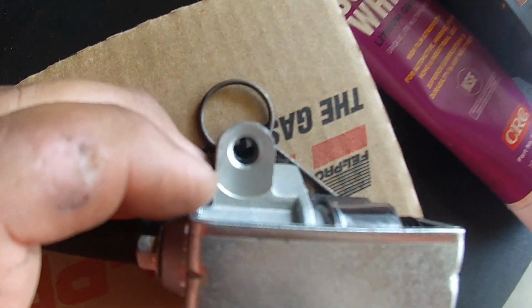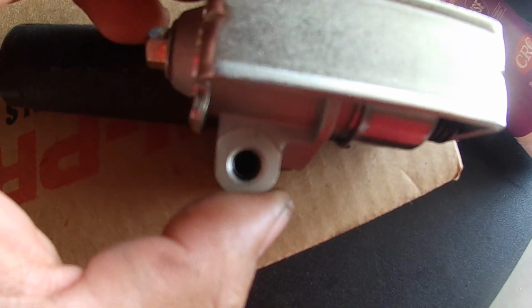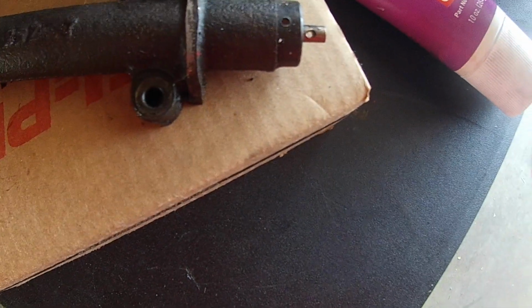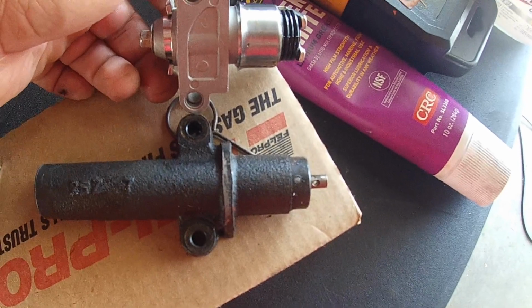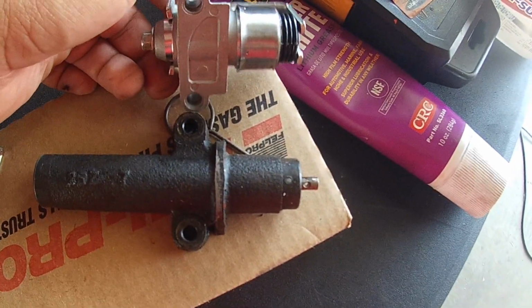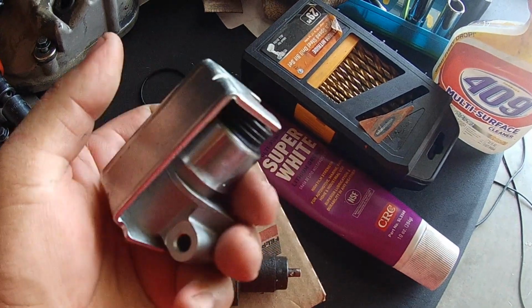Yep, they line up. It's all the way through there. It's all the way through there as well, so they do line up. They are the same height, so you will have enough tensioner on the tensioner idler pulley once you pull this. But if you can, get your hands on this one, way better tensioner.